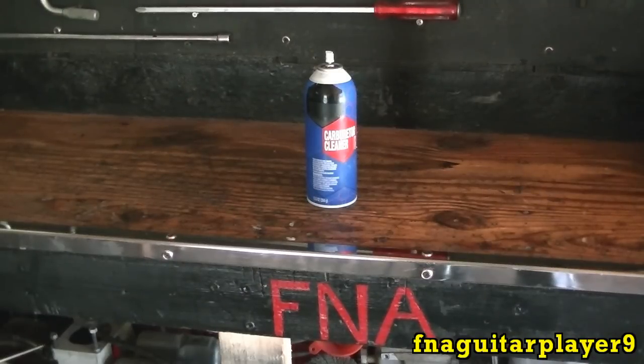And what I was going to say about the chainsaws is, chainsaws are two-stroke, and if you use a starting fluid or even carburetor cleaner to start it, there ain't no oil in it, because a two-stroke has the oil and the gas. So if we're using a starting fluid or a carburetor cleaner to start a two-stroke engine, you need to use a flammable penetrating oil.